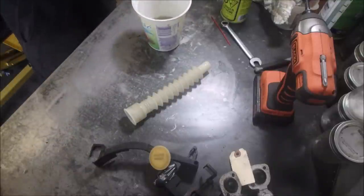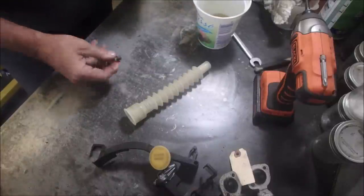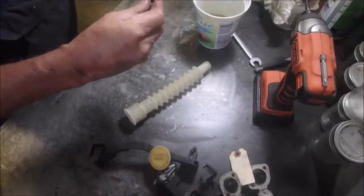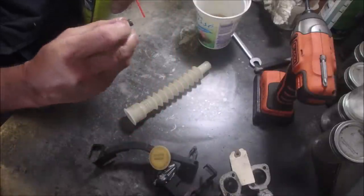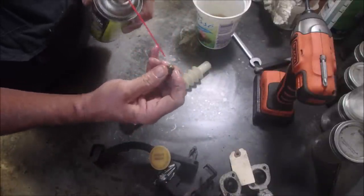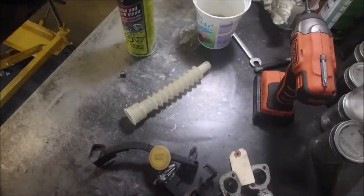And one more thing to check, the million-dollar bolt. It's actually a jet, right? We have to be able to squirt through that direction, and then from the top, we should see a T. Well, let's plug one end with a finger. It should go L. Same thing. No, it's not. It's plugged. Dirty dog. I'm glad you caught that.